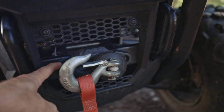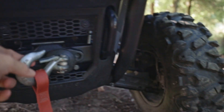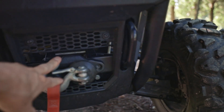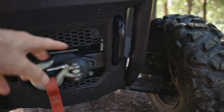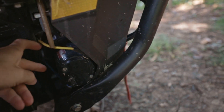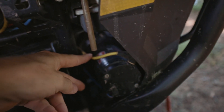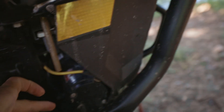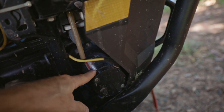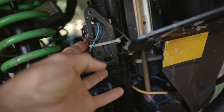You can run a roller or a fair lead off the front if you want. This bumper is really handy to keep your winch line off your fair lead or roller — I'll leave a link down in the description below. As for how this is wired up, you've got two wires coming off the terminals of the winch — positive and negative — running to the winch motor, and those go up to the solenoid.